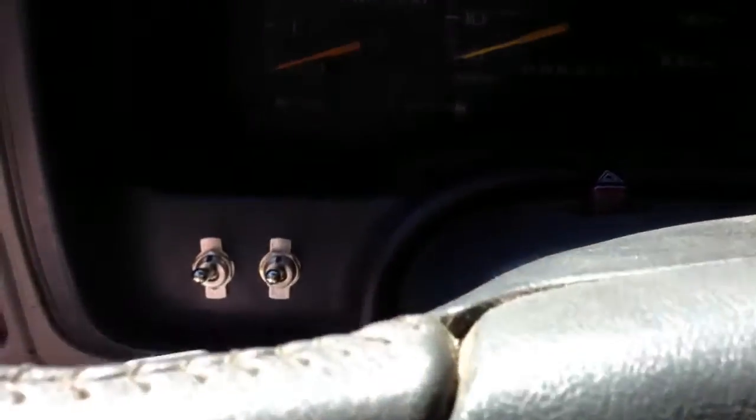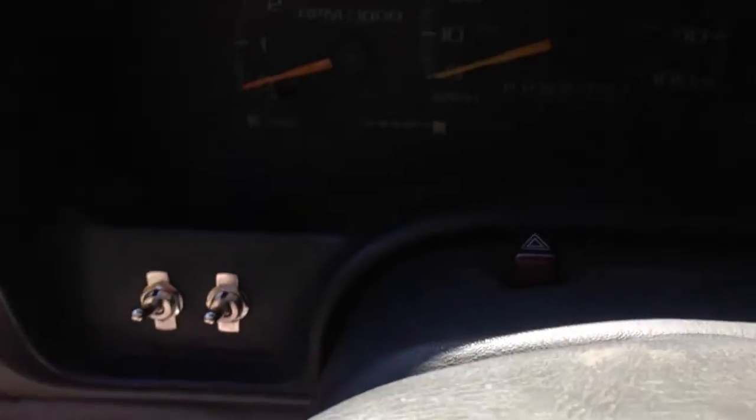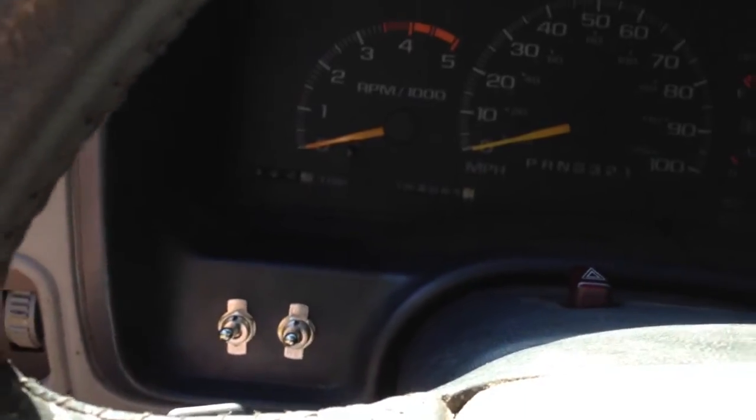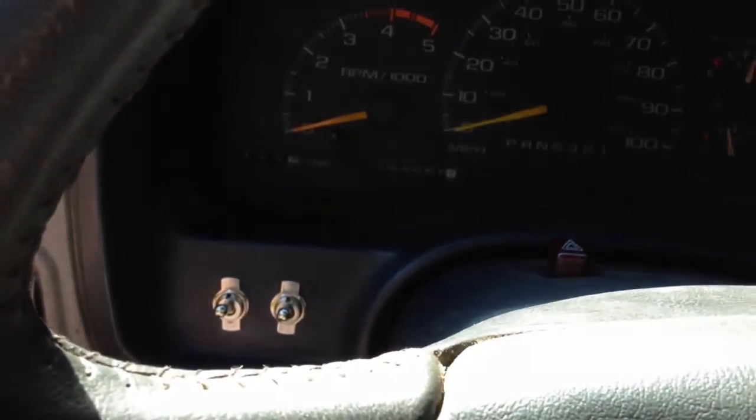Take that out. In the middle plug, top row, pins number 6 and 7 have no wires in them. What you do is go to a GM dealer and they give you the little pins that go in the ECM. You crimp on your wires and run your wires to the switches and ground your switches. I have mine grounded there.